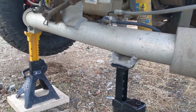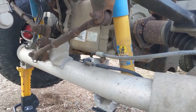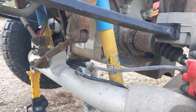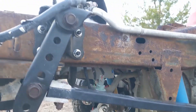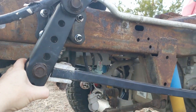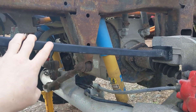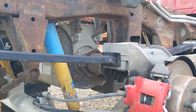You can see the jack points are actually on the axle itself, so the motor is basically on the frame. This Watts linkage here is unique to the lead-acid Ford Ranger — the nickel metal hydride does not have that. I'm going to have to end up replacing all of this because it's just corroded and rusted. They replaced the rear leaf spring bracket due to rust but preserved the front one. This composite leaf spring is also unique to the lead-acid Ford Ranger Electric — for the nickel metal hydride, they replaced it with standard steel leaf springs.